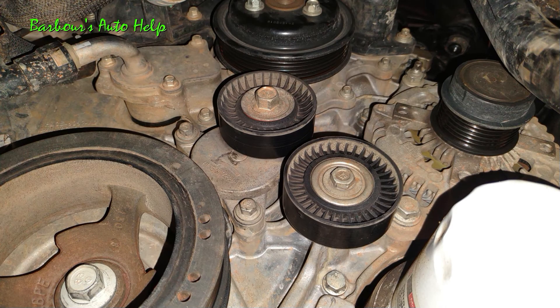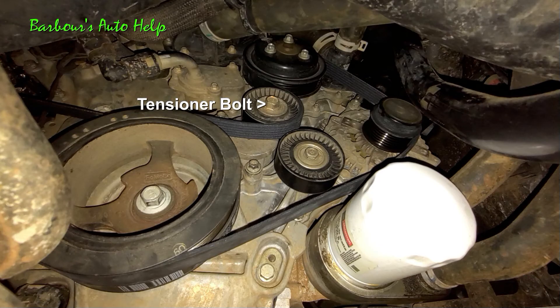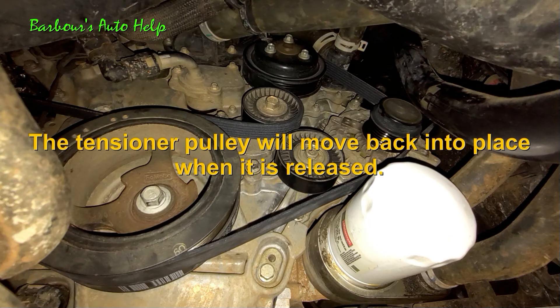At this point we need to go ahead and put our tensioner back on, put your two bolts back in, and torque them down to specification — you'll need to refer to your repair manual for that torque spec. Then once your serpentine belt tensioner is installed, go ahead and route your new belt around your pulleys. What I like to do is route the belt around all of the pulleys except for the idler pulley down at the bottom, leaving it dangling there. Then I put my 15 millimeter socket and ratchet back on the tensioner bolt, turn it counterclockwise until I can, with my opposite hand, grab the belt and run it up over that idler pulley. Once the belt is around the idler pulley, carefully let the tensioner rotate back clockwise, applying tension to the belt, and then we're good to go.